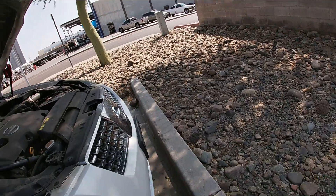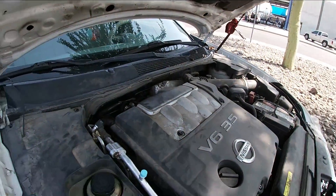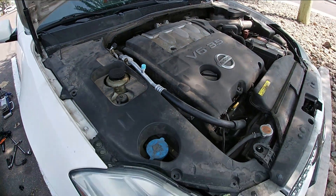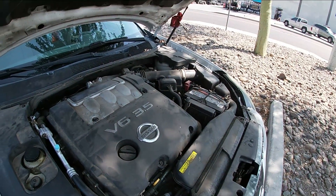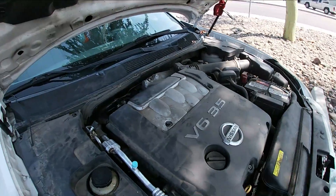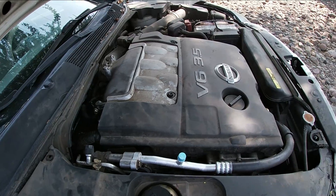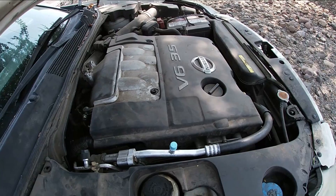Going in from the side is a whole lot easier if you take off the tire. I didn't bring anything to remove the tire, but right in between the tie rod end and the frame subframe you can get your arm up in there. We have a link in the description for the Bosch O2 sensor with the right part number, because they have a lot of different options. This one is particular for the five-wire. For bank one, the way you can tell on Nissans, it's closest to the firewall, so cylinder one is going to be on the left side when you're looking at it from that angle.